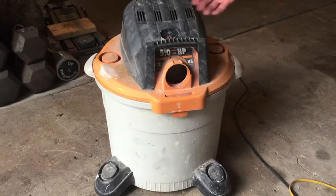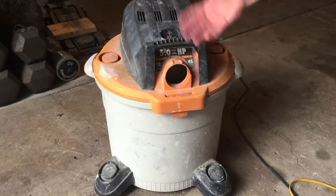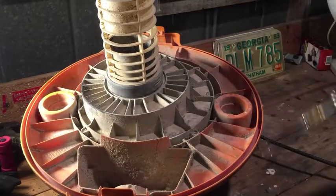There's a slight smell of electrical burning. I'm going to take it apart, get to the motor, clean it up, and see if that helps — see if I can get some more life out of this. Based on how dirty this is, it's obvious that they've been running it without a filter. That's probably not good for the motor.